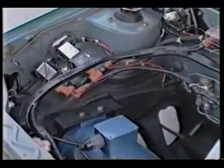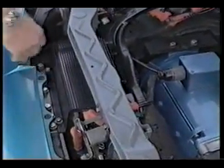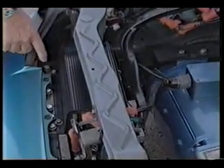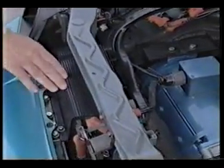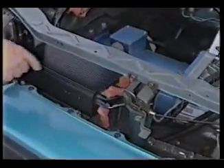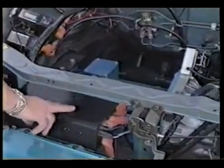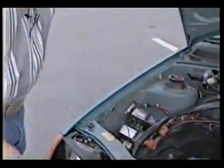This is a controller box, a Curtis control box. It cuts the amperage down. Here's what's real good about electric automobiles — all electric automobiles that have this technology in them create heat. They've got to have a fan to blow on this Curtis controller because it gets hot. We don't want that to get hot. We want to keep it cold, because once it stays cold, you save on all the computer chips that are in this controller.